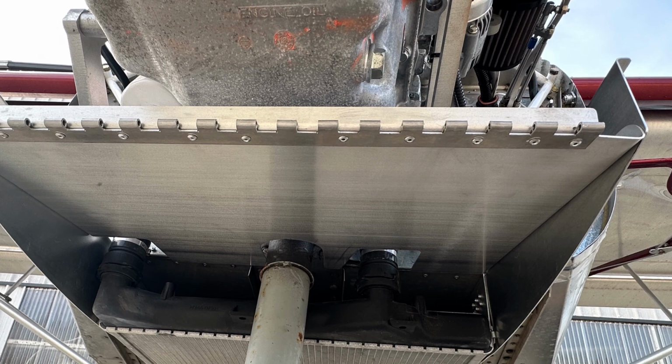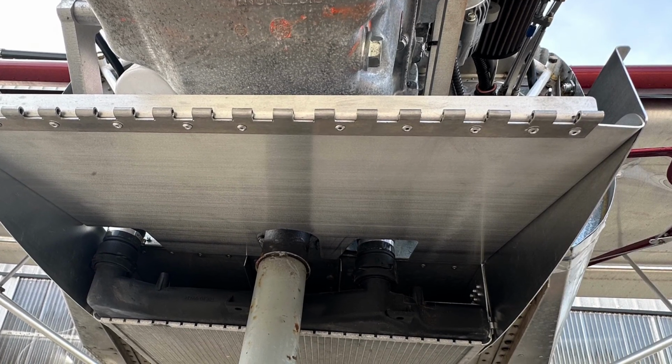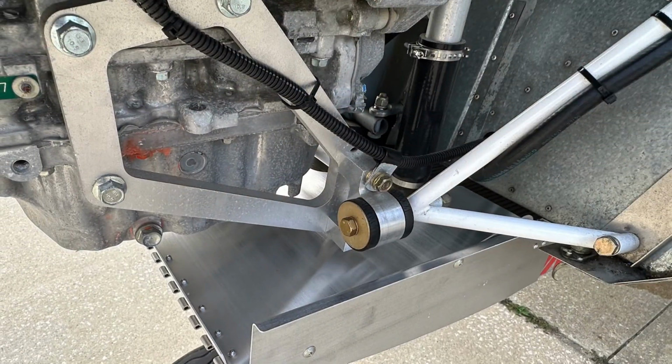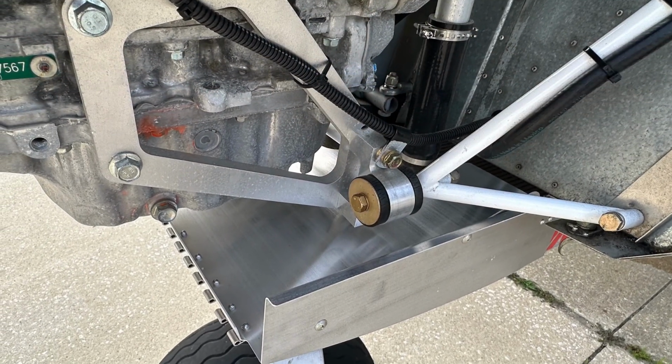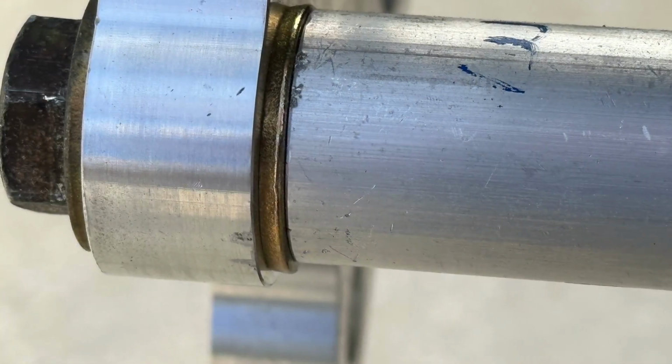And this is nothing new. This has been on the 130 engine and late 150 engines. It's basically an air box that's generated in front of the firewall, and the air is routed up inside to the top of the radiator and then dumped out the bottom.